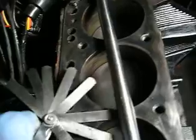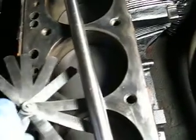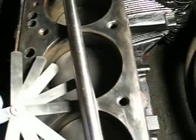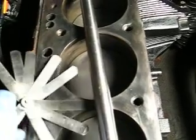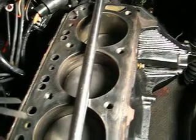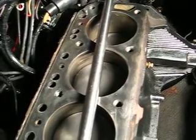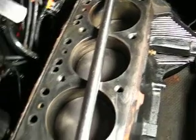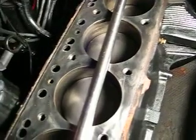Here's the .003 — it slips right in there without dragging, and if I hold this flat, the .004 stops. So this has three thousandths of an inch of gap, so it's well within specs. And the cylinder head was .006, so I got a little bit of warpage, not much, not enough to mill it — so we're just going to reassemble and good to go.